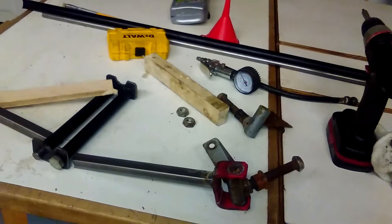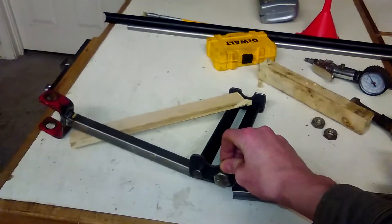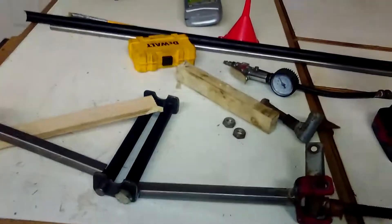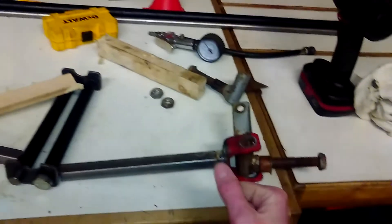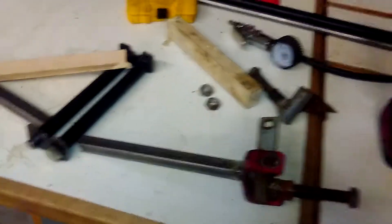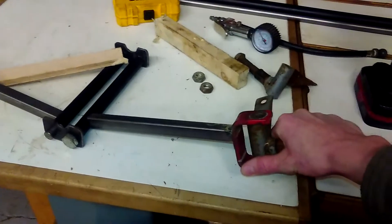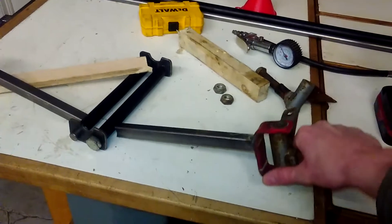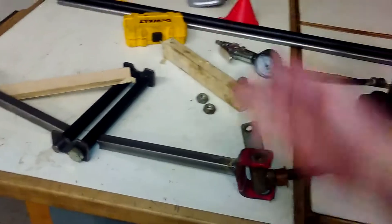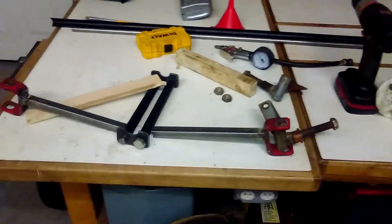That should be all I need, and a little caster or two. I think the caster is going to be achieved with the whole setup, which will make the wheels want to go back a little bit instead of straight up — which will make it hit bumps better. It won't try to push the thing straight back as much. A little bit of angle like that would be good for it. With the tie rod placement like this, the tie rod will actually act as a control arm and keep the wheel from wanting to travel on that radius as well. That's all about the placement and the geometry of the steering.